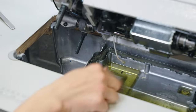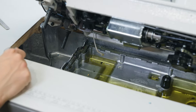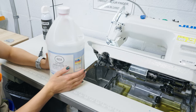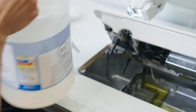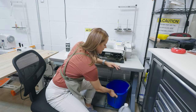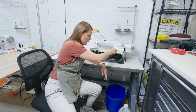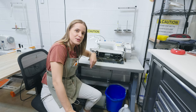Now we're going to get a little messy. My oil trough has stuff floating in it — little threads, little sequins — and it's very yellow. Just to give you a frame of reference, this fresh oil here is clear. Obviously we need to get this drained out and get a fresh oil bath into this reservoir. That's where the bucket comes in. I've got my kitchen mopping bucket set right under here, because right above is a large screw holding the bottom of the reservoir sealed. Exactly like a bathtub drain, I'm going to unscrew that screw — there's about a quarter-sized hole in the bottom and it's just going to start leaking all of that oil out. Then we'll get rid of that oil and refill it with the clean stuff.